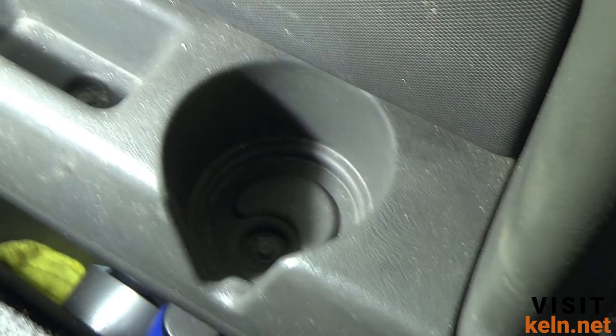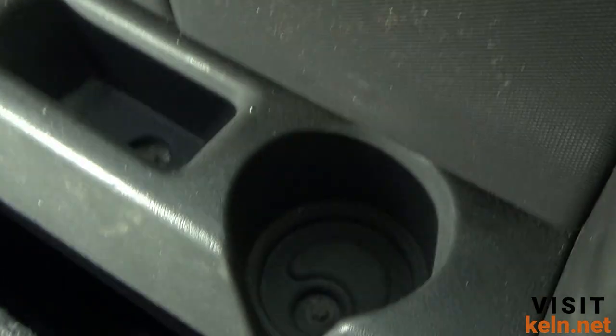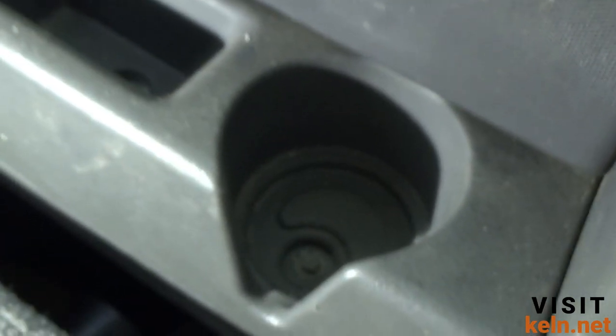This is going to be more of a hassle than I was planning on. In order to give myself more access I'm going to take the door skin off, and to do that I have to hit that bolt right there and another one off to the cassette holder — the handle. The lighting isn't going to be great but let's do it. These screws, just like the majority on the interior of the vehicle, are going to be seven millimeter heads — keep that in mind.